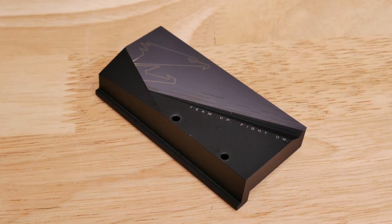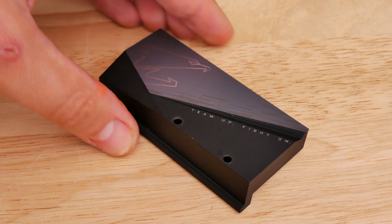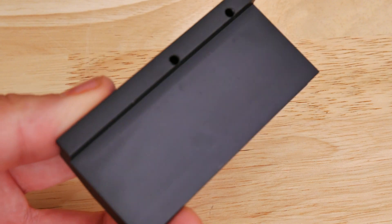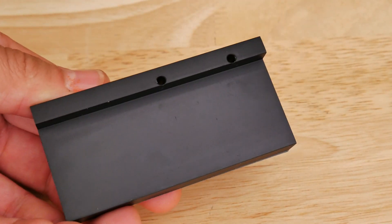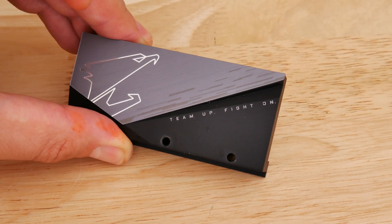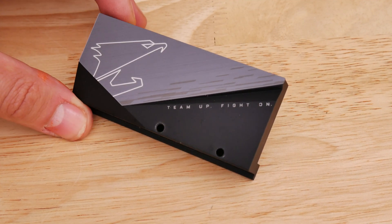Now there is one issue with the motherboard, specifically with the M.2 heatsink. I wasn't the biggest fan of the M.2 cooling arrangement on this board's big brother the X570i Aorus Pro Wi-Fi, but here it seems Gigabyte has slipped up again. This large heatsink which sits on top of the chipset and the M.2 heatsink isn't actually making any thermal contact via thermal pads — either with the chipset or the M.2 heatsink — and it's just sitting metal on metal, which is never going to be that efficient.